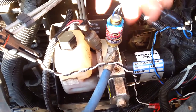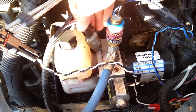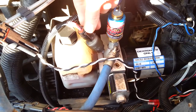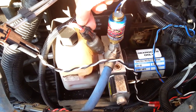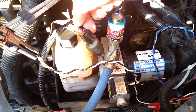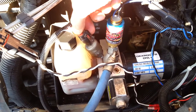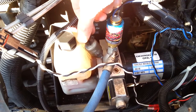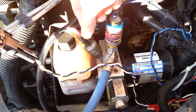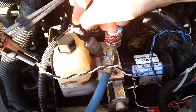With the original configuration — because you see a bunch of wires, I'm upgrading it to a better design — there was a transducer sitting in place of a little valve here. This transducer has three wires on it. It talks to the ECU. Two of those wires look for pressure: one looks for 1200 psi or below, the other is looking for 1400 psi. So when you turn on the key and take it out of park into drive, the ECU talks to the transducer and asks how much psi is in the lines. If it's less than 1200, that wire signals the ECU, which then tells the electric motor to come on.